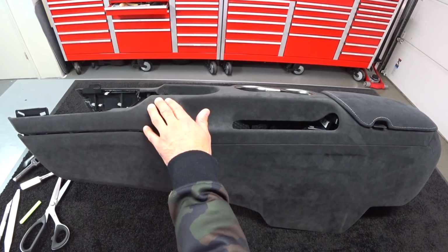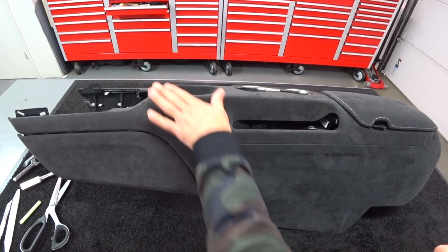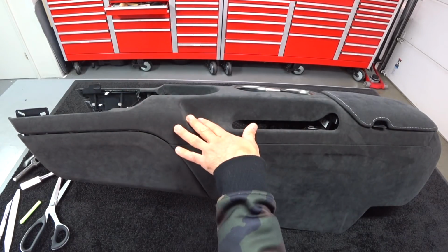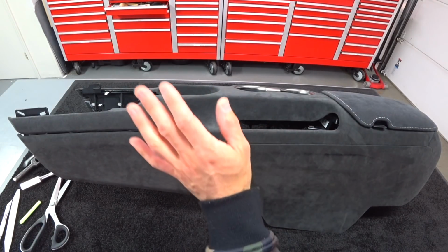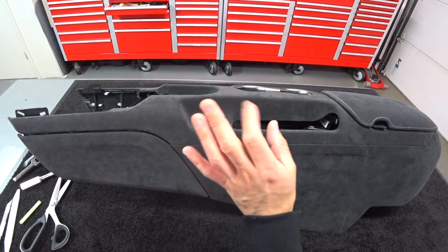this is hard plastic. So with upholstery, a lot of times you could do a thin foam underneath, wrap it, stretch it, staple it. When you're doing automotive panel work, you cannot do that on something like this because of the tight tolerances between the two panels, how they snap together. So you cannot apply foam. Now, all of these little recesses in here and all the little curves and undercuts make it extremely challenging.